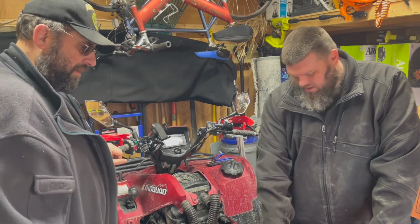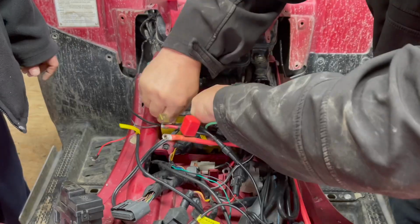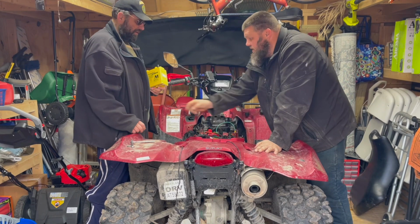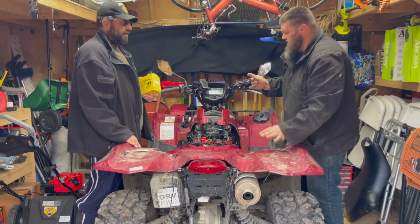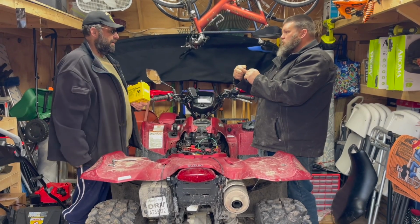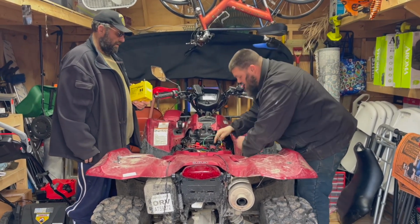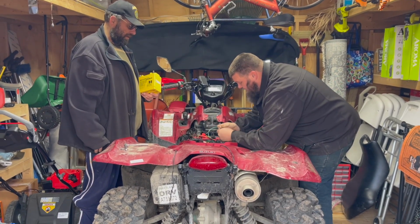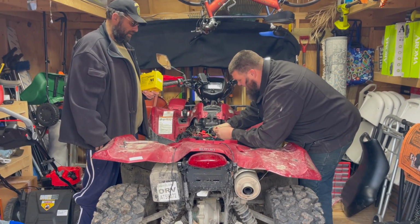And here's a clue. We dumped tons of fuel down Roxanne's throat to try to get her started. It's not fuel. It's definitely not compression, which leaves... Maddie, this is your work, brother. This had a ring terminal, a loop on it, and it went on the ground. And it was this ground, factory, and this ground, factory. See? Black and white, black.